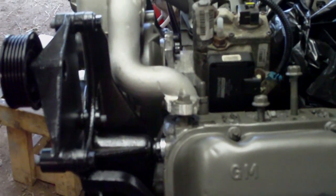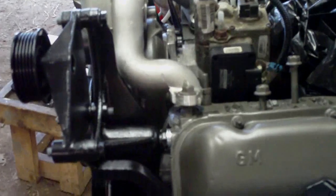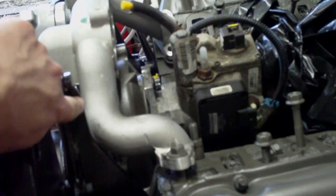I'm hoping that if I remove this lifting bracket — which was bending all to hell when I used it anyway, so it's not like I was going to keep it — I won't need to grind too much. But looking at the big gap there and the lifting bracket, just removing it probably won't be enough. Even with the lifting hook removed and some washers and spacers added, there's still a pretty substantial interference problem. It looks like I'm going to have to shave probably at least three-eighths of an inch off here, and I'll probably have to round out this spot on this bracket as well.